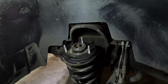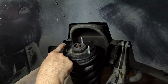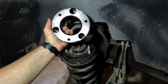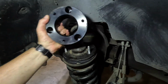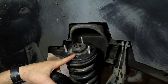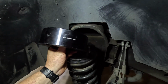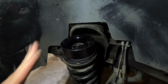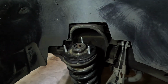And then the other thing that I want to show you is that since this orientation is different from the orientation of the spacer, you will have to get these 3 small holes in the same orientation as this was when you uninstalled it, when you pulled it out. So to hopefully save y'all some time, where this part number writing is, I found had to go up in this front corner. To get the orientation of this right, what I used was a pry bar.